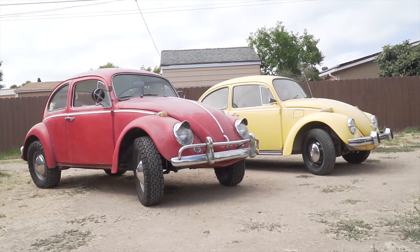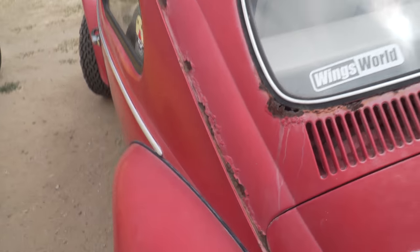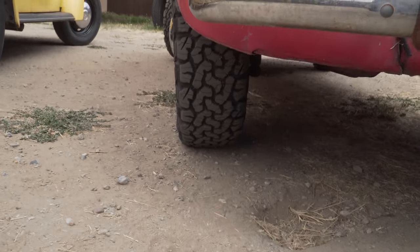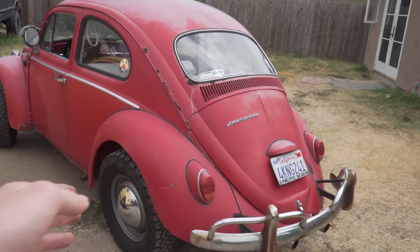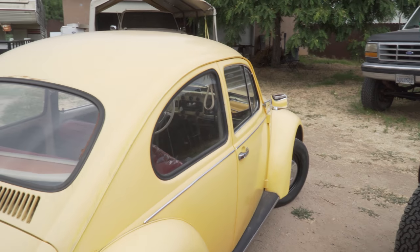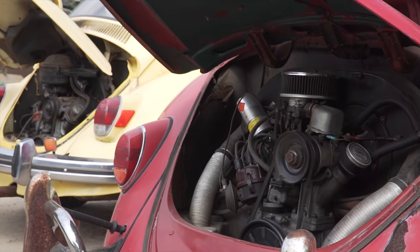Let's discuss the differences between the two that make this one a better candidate for Class 11. The first obvious difference is the condition of the body — the '64 does have some significant rust. Yes, it could be fixed, but it's easier to start with a car that doesn't have any. The worst spot has a little hole through it. But that wasn't the only reason. The other big difference is this car has camber when you lift it because it has a swing axle rear end, whereas the '70 has an IRS rear end, so lifting the rear won't have that crazy camber change. The switch from swing axle to independent rear suspension happened first in '69, so for a standard Beetle with IRS you're only going to find that in '69 and '70 — which is what I had been looking for.